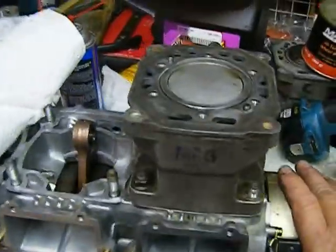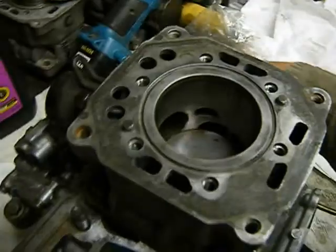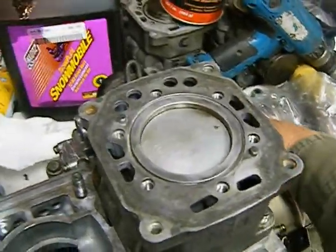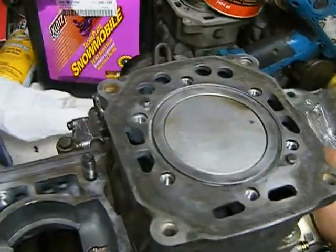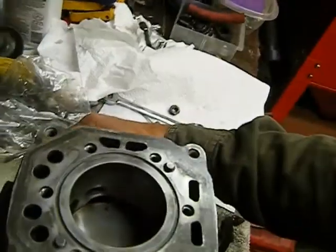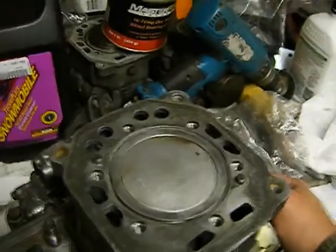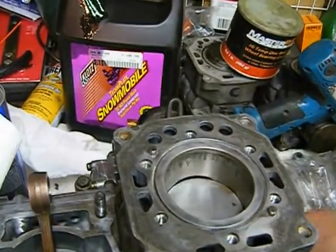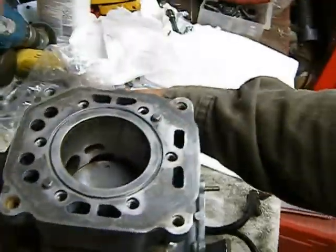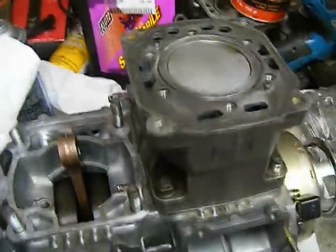Now there we have a single cylinder. As you notice it comes down and we have some oil in there, but it's up and down very nice and smooth — not coming over TDC or anything crazy. Everything seems to be working quite well, nothing's rubbing in there. We have our rings on right and our pin is in the correct position in our ring land, so we don't have a big wear spot rubbing the cylinder wall raw. That looks like it'll be just fine.